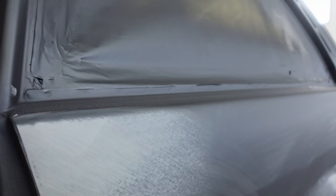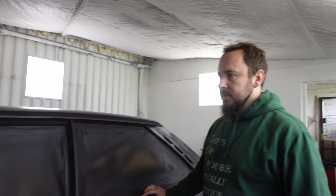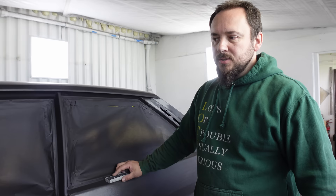It's gone. And you can see I had a couple of little, very shallow ones all over the car. But it's looking amazing, I have to say. When the car's all one colour again it really does bring it together. That is how I get a run out of primer - I use a harsh paper and a hard block and knock it back. I mean it's primer, it's not paint. You don't have to worry about much at all, so just go for it.